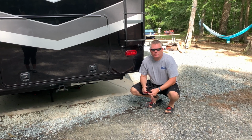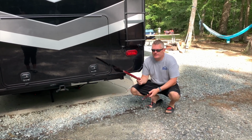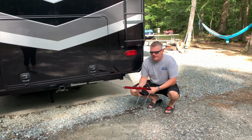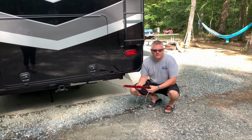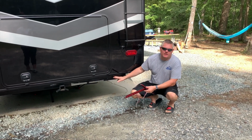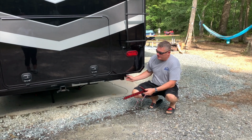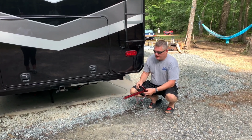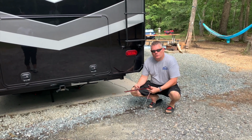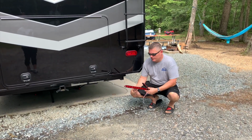Alright guys, so the simple solution we came up with are these 11 LED light strips that are only about 1.5 inches thick. They're going to mount to this 2-inch square tube that's beneath our rig, which is completely hollow. Should allow us for an easy install of only 2 screw holes and 1 hole for the wires.